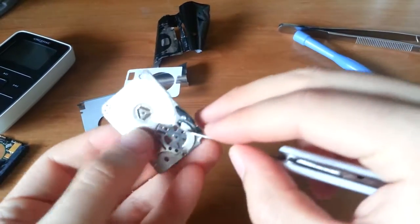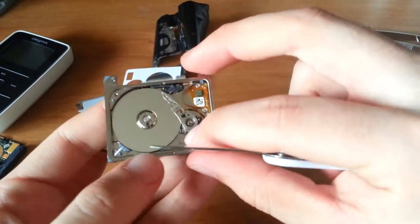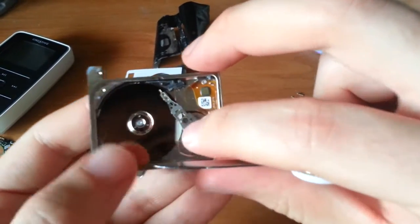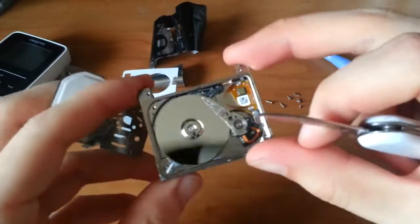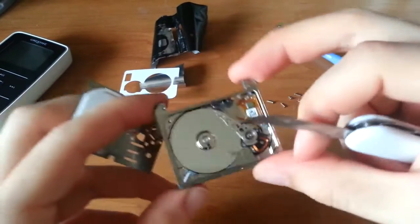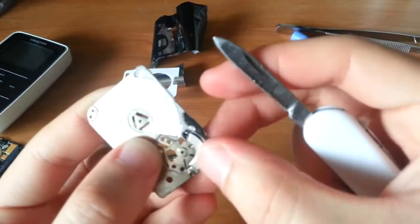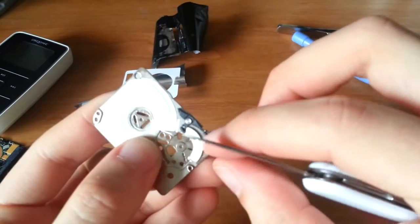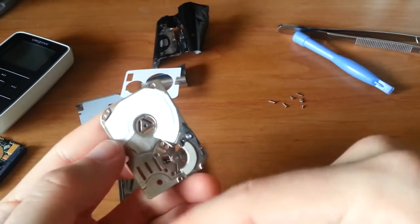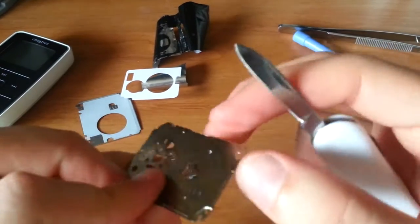And so you can see the small neodymium magnet, which is how it propels the head there. And it's super shiny. You can see me in there. Hey, it's my eye. Anywho, very strong magnet. This is the parking assembly that locks the armature in its parking position when it powers the drive down to prevent any scratching.